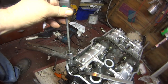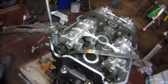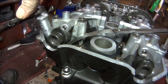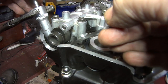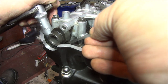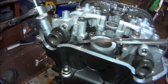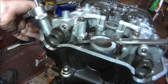Okay, so we've got the screwdriver in there. Just twisting it tighter and looser till we get the feeler gauge dragging nicely. Then we can tighten the socket up. I know there's a lot of weight on it, but I'm allowing for that by lifting it up slightly. Screw it down till we get that little dragging feeling, and then keep the screwdriver taut and lock the socket off.